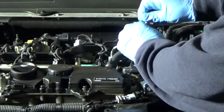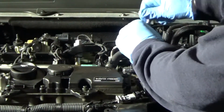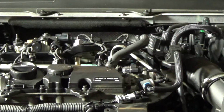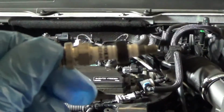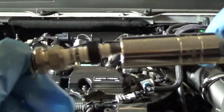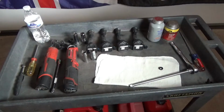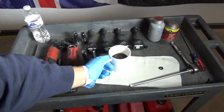I don't know if you can hear it squeaking, but they all squeaked. And really tough. And let me show you, see how that sticks to it. Whether you have rubber or plastic or whatever in your spark plug socket, you need it to take it out, but don't use it to install it. Okay, let's talk about tools to remove the spark plug. Let me put my Motivation lubricant down.